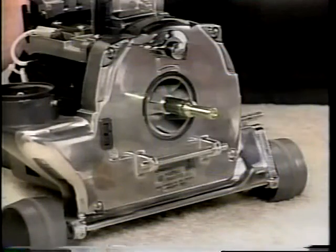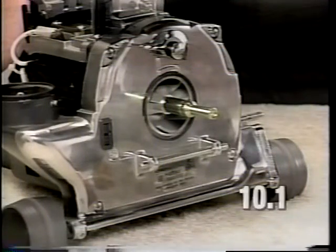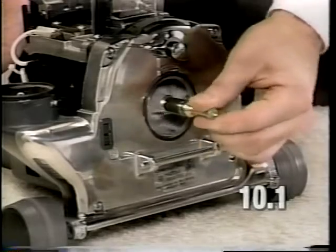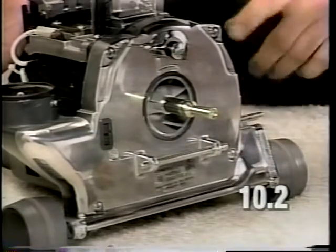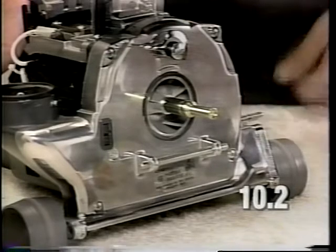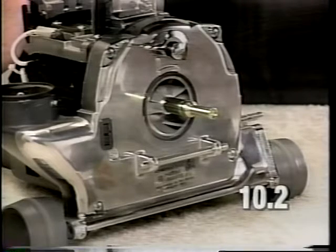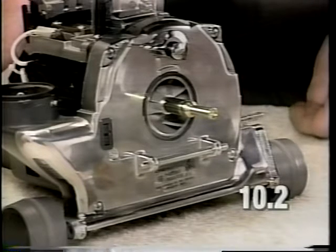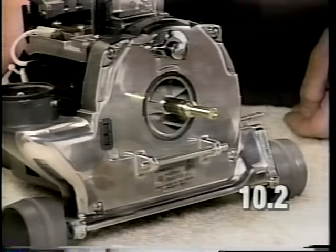If the problem is a clicking sound from the motor area, you may have a foreign object in the fan chamber. You want to rotate the fan to make sure it spins okay. You could also have excess sealant hanging down inside the fan case and resting on the fan blade. This will cause a ticking noise as the fan goes by the debris. To inspect the fan chamber, remove the fan case.